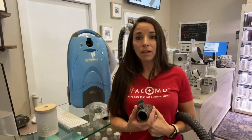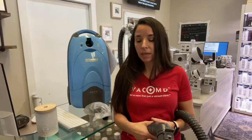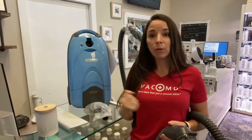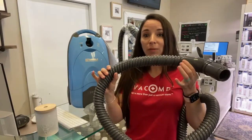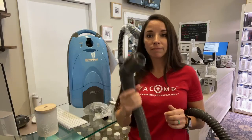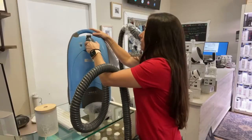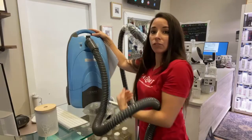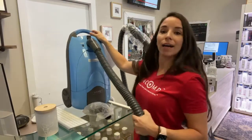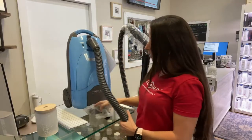Also, a lot of these vacuums actually — almost all of them — come in and they're not turning on. Well, this vacuum is designed to pull behind you, and what do you pull it with? Your hose. And what gets the grunt of that pulling? Your swivel assembly. This assembly goes right here into your vacuum, and there is a lot of electric going on inside there. Every time you pull your vacuum, that swivel assembly is getting the grunt.